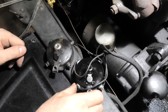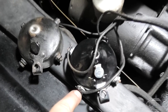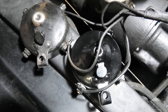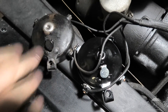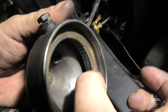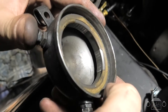I've already gone ahead and changed the wires from the old timer to the new one. The easiest way to do it is to undo them one by one off the old one and move the corresponding wire across. That way you don't get the firing order mixed up, because it wouldn't run at all if we got that stuffed up. You can see there's a really bad groove all the way around on the old timer — it's really badly worn, so the engine wasn't running very well with this one.